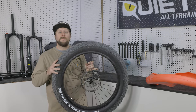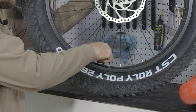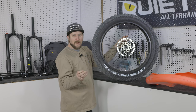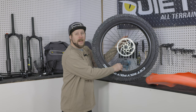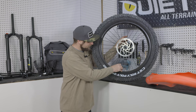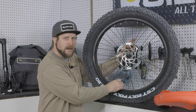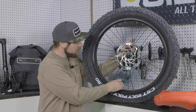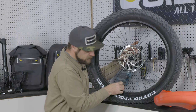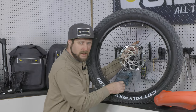The first thing we'll do is deflate the tire and remove the inner tube. Go ahead and unscrew the Schrader valve cap — it has a round edge. Push down to hit the key in the Schrader valve and release the air. Make sure to deflate all the air from the tire, pressing down to get as much air out of the tube as possible.